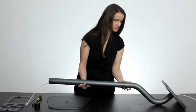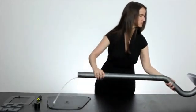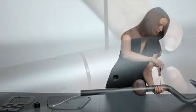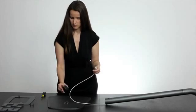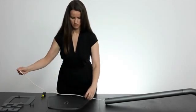Insert the tube connector into the desktop S-tube. Align the holes with the set screws inside and gently turn them using the supplied hex driver counterclockwise to bring them out to connect with the tube. Further feed the USB cable. Locate the end tube connector, feeding it through the end with 2 holes first.